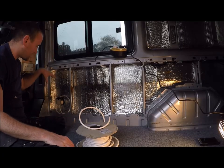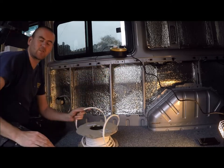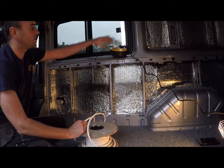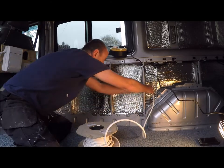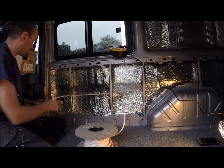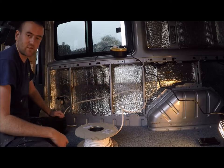Once the fuse box is in place, I want to have some sockets around the camper van. It's important to think about this beforehand because you need to get the cable in before you put the panel on. I'm going to have a double socket on the floor over the door — that's going to be for the heater and maybe an extension into the awning. I'm also going to have a socket up here on my work surface. I need to thread it through, make sure I have enough length, cut some extra, and get it coiled up and ready in place.